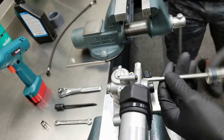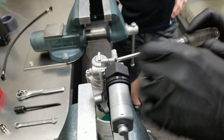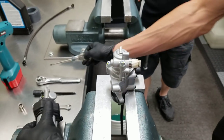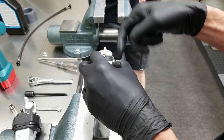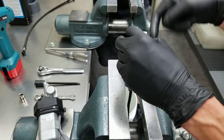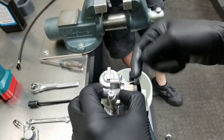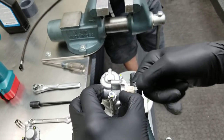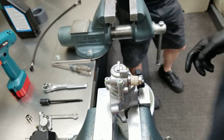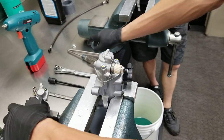So tell us why you're removing that pump there, Martin. To reset the plunger. Zero, basically. Zero everything up. So three Phillips screws there. What's happening is he's pulling a plunger down in the cup of oil up to zero. You can also help this before you take your bike apart by setting it down to zero on a 2001-17, or on a 2018 model bike, set it to one rider, no luggage, and that's effectively zero on the old bike. Same setting at that point.